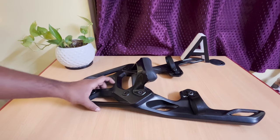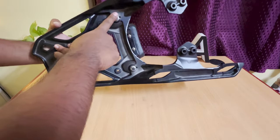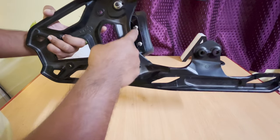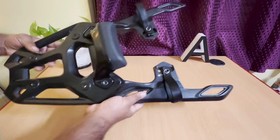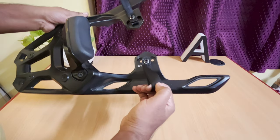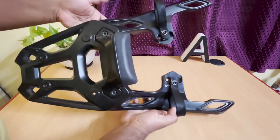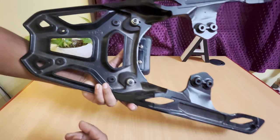This is the carrier itself. I have already mounted the backrest assembly, which is a pretty straightforward process. I used 6 Allen bolts and nuts and 2 screws to mount the backrest assembly. Also, there are 2 nylon straps which can be used as a bungee cord holder, which you can directly buy from Bajaj or create on your own just like how I did here. Here you can see how I have mounted it all together.